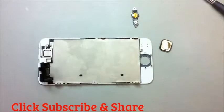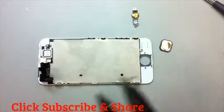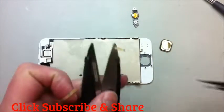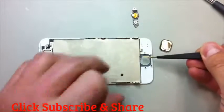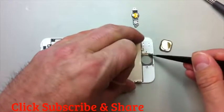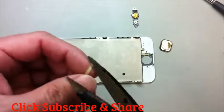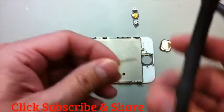So what I'm going to do is cut some 3M adhesive and put it inside the area where the home button goes. I would recommend you cut this as thin as possible and try to put it as far to the side, outside of the button as you can. What I'm doing here is going to work, but it is going to impede the movement of the button slightly. So you kind of want to avoid getting the adhesive on the button itself.